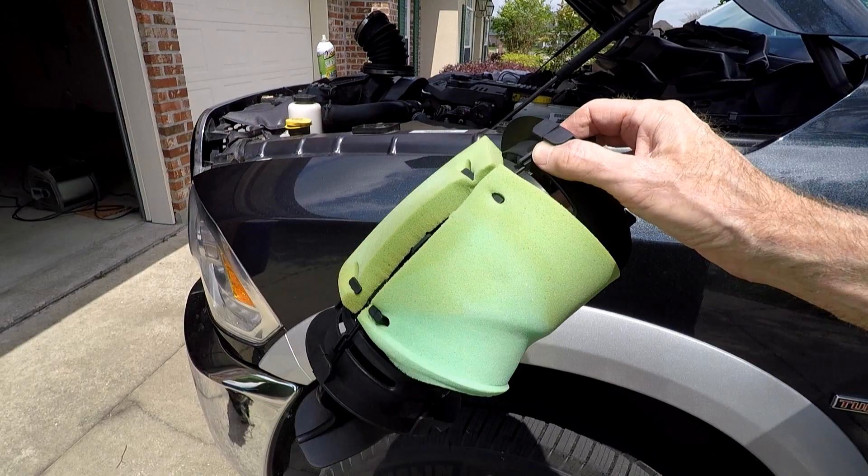In conclusion, from the data I gathered, you're getting better performance with the baffle. I'm leaving the foam off because of the concern many people have that it deteriorates over time — mine looks fine but it's not a pretty thing. It unclips and clips back on, so you can always put it back. People on forums swear they're getting better fuel mileage when they take the whole thing out, and we've seen that's true — but it is at the cost of turbocharger performance. You're building more heat in the turbocharger, getting less density on the turbo output, and hotter, less dense air going into the engine. A turbocharger is really not there for fuel economy — it's there for performance.